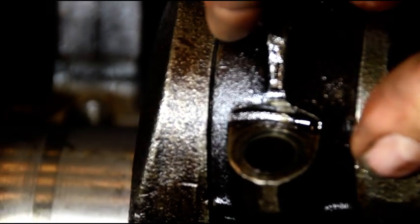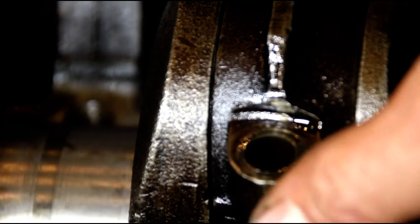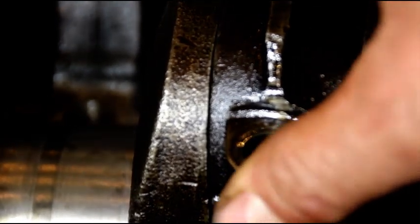That has been worn away. I'm going to show you what a cap looks like on there. You can see that shucking back and forth. Depending on which one, there's anywhere from 25 to 28 thousandths that that crank has worn.